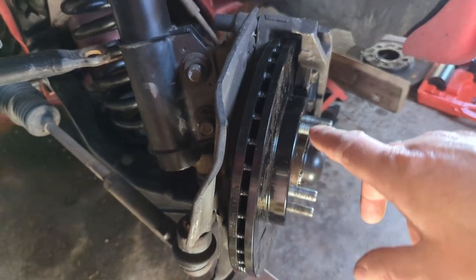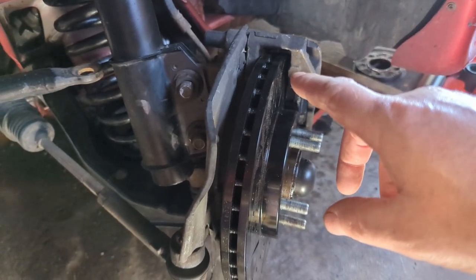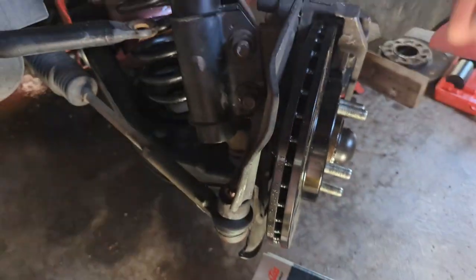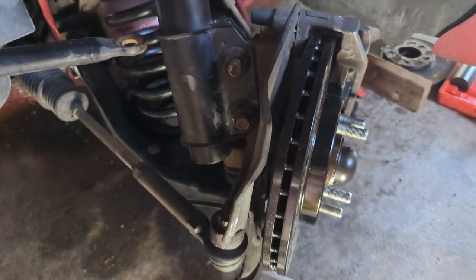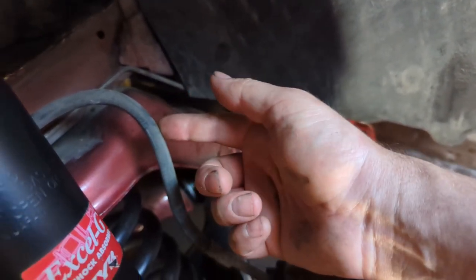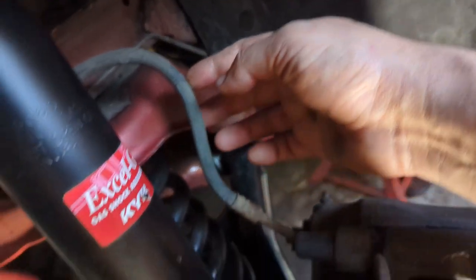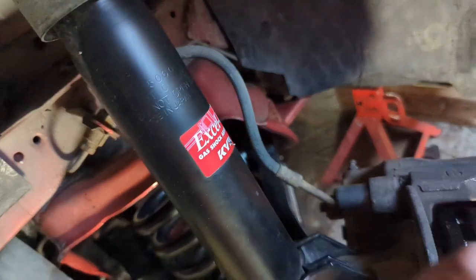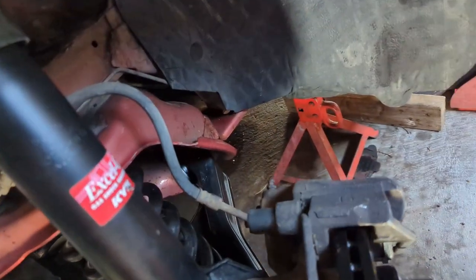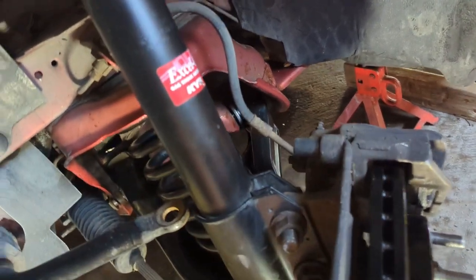Additionally I got the new brake rotors and new brake pads, and the next thing I'm doing is replacing the brake hoses — the actual soft lines. I've got five of those because there's two in the front and three in the back, and those are going to replace this 30-year-old rubber that's sitting here, because if this ruptures you have no brakes, and that I think is a bad thing. So I'm just going to replace these and at the same time take the opportunity to exchange out all of the brake fluid that's in the system because it's old and crusty.